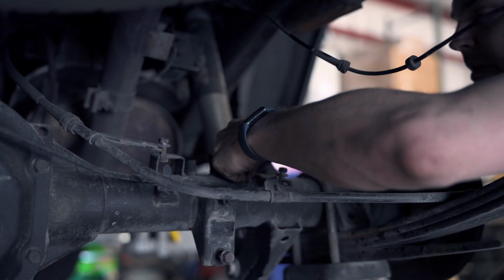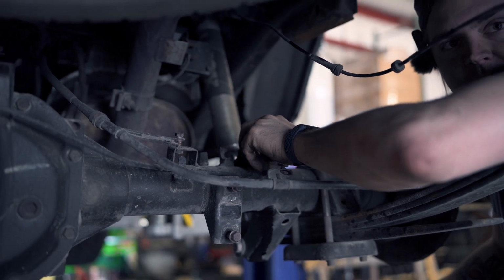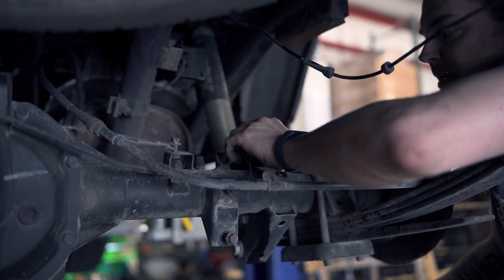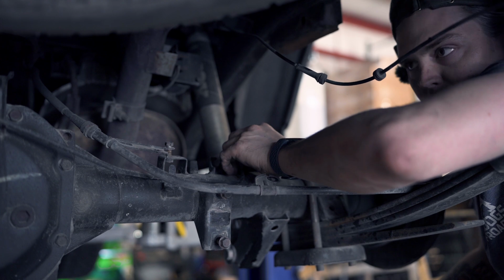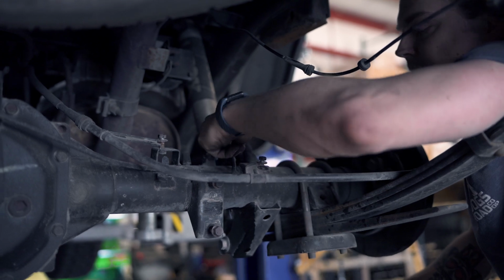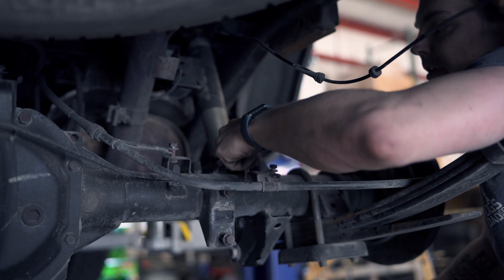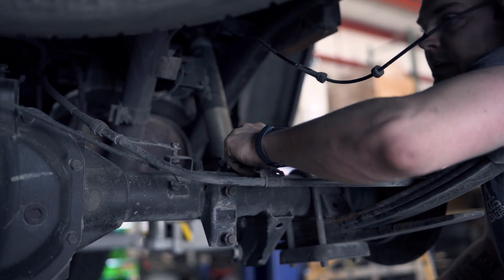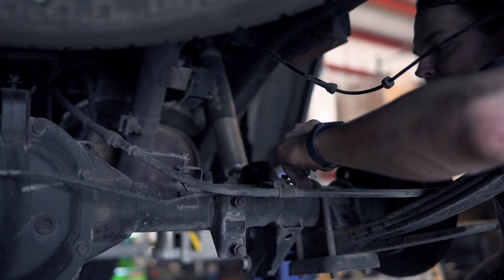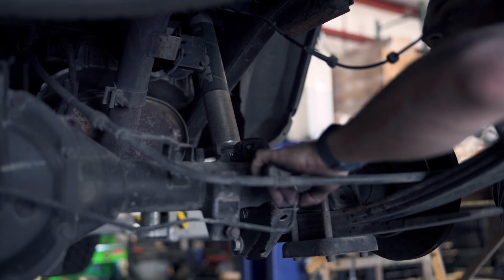That's the moral of that story. We don't have the proper crowfoot wrenches that you'd use for brake lines in the shop with us right now. So I was just using a regular 10 mil. The other side came just fine. This side was quite a bit more rough looking, and I rounded it. So I used some vice grips and was able to pop it without damaging anything, but it is rounded. I think we'll still be able to use this and just be a little ghetto, but make sure you have the right tools if you do this and don't mangle stuff like we do.